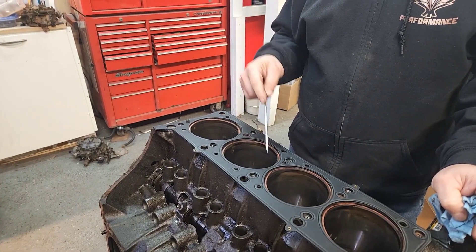I have my reasons against MLS head gaskets, especially in boosted applications. An MLS multi-layered steel gasket has very little chance of blowing out — that's a good thing. But a conventional head gasket can be a really good fuse: if you get into heavy detonation or something goes wrong, the weak link is the head gasket popping, no other damage done. With MLS gaskets, they're less forgiving — you might end up cracking a piston, torching a piston, torching the block or head, while the gasket still holds.